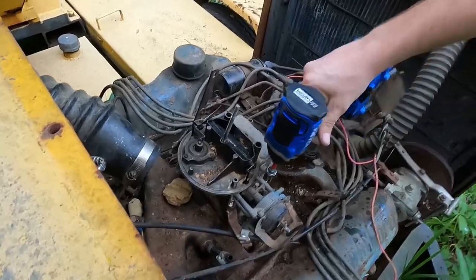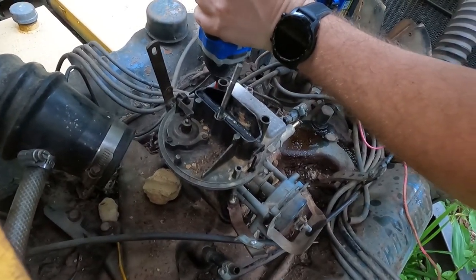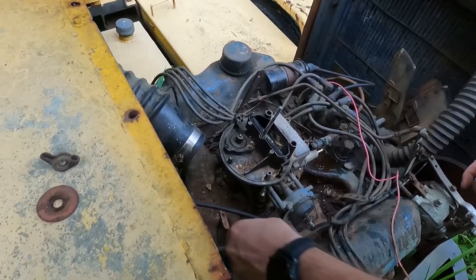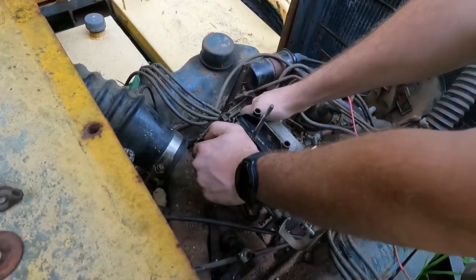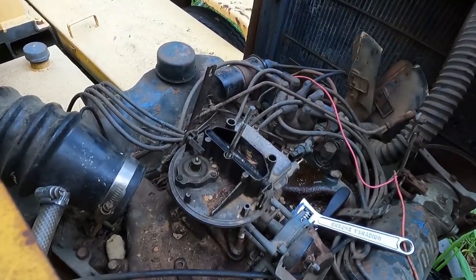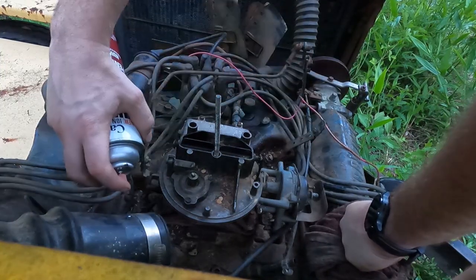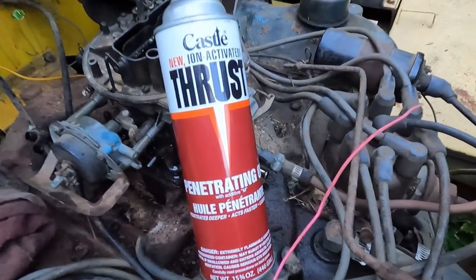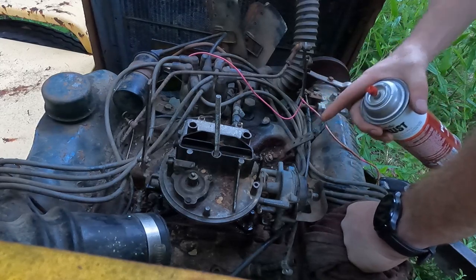That's a good color for fuel — it's all rusted on. We're gonna go get some penetrating oil and we'll be back. What this stuff does, if you don't already know, is you spray it on the studs and let it soak in for a little while. It's a very thin lubricant that will penetrate between the threads of the stud and the body of the carburetor.